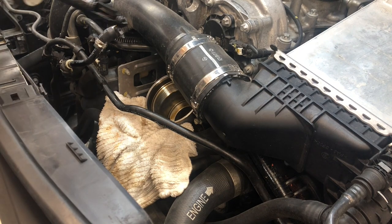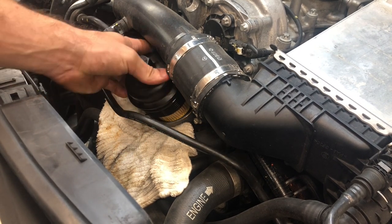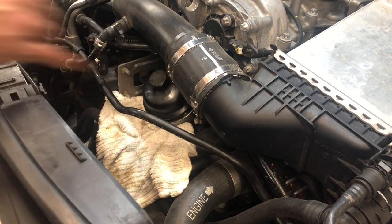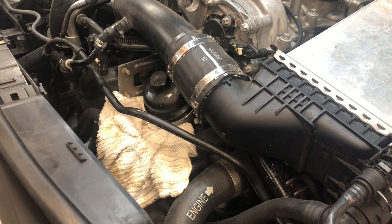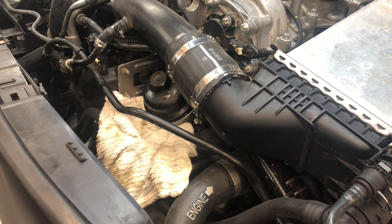All right, guys, I don't think I need to bore you with the reverse process here, but literally just putting this oil filter back down in its spot and tightening it down. The actual nut on the cap is the torque value. You torque it all the way down, loosen it, and then tighten it another to 25 Newton meters. So piece of cake, we'll tighten it down, torque it, and we'll go down, put the oil pan plug in and fill her up with oil, and we are done.